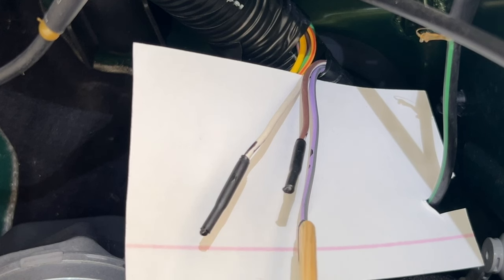I've wedged it out — and what better thing to wedge it open with than your spotlight, which you'll need anyway. There's the wire right there. We're going to use the wire that came from the glove box, wire it to our new wire using a butt connector, and feed the new wire out the back. I wire-tied the butt connector to the original harness and ran the red wire all the way back — the plug is at the back. Remember, that's a positive, hot wire — you don't want it dangling or rubbing against any metal. Keep it secure so it doesn't short out.